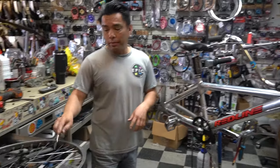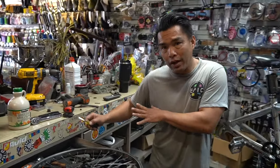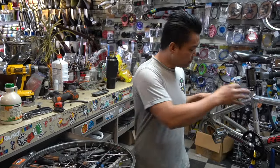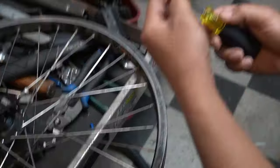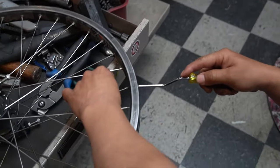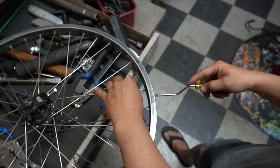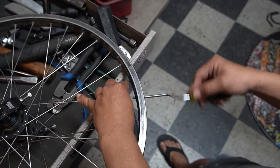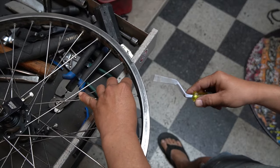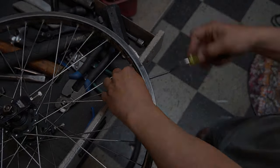So I'm going to continue taking the wheels off, and we're going to relace it first to get it out of the way. I'm going to clean the hub, and we're going to start on the bike. Follow me, guys. You can see I've got this little fancy tool here. It's a nipple driver is what we call it. I don't know if some of you guys call it that, but I'm just unscrewing this. We're not going to save those nipples, but I just don't want them on the ground because I'm going to slip. Basically unscrewing the whole thing, dismantling, and I'm going to start cleaning up all the spokes, clean up everything.